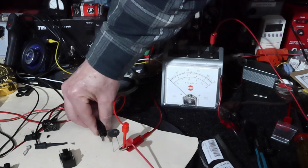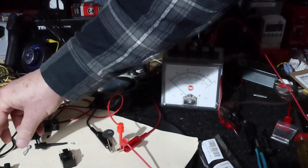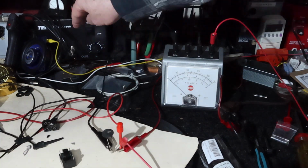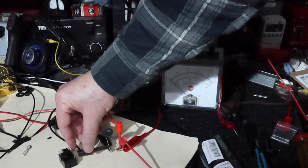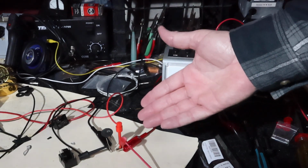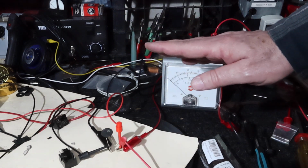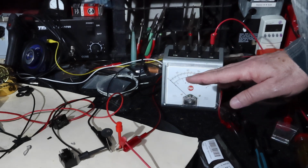And what I'm going to do is have this go through the CL90. Like I say, you've seen me use this on my channel several times. And what I want to do is measure the voltage across the CL90. So the CL90 is a negative temperature coefficient item. I use this to limit inrush. So as this thing turns on, it gets hot, and as the temperature goes higher, the resistance goes from high to lower. So it's a negative temperature coefficient.